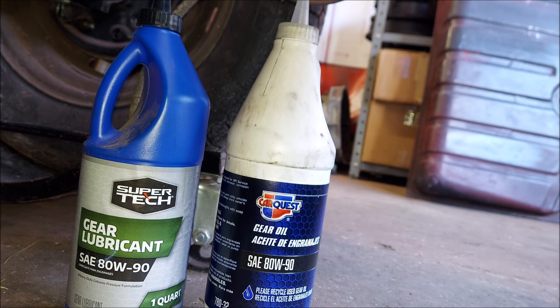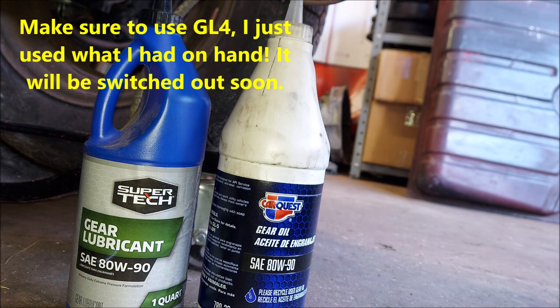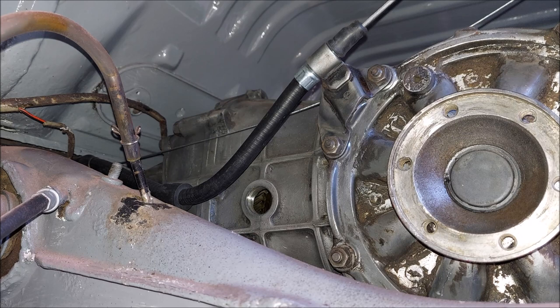Now you can use what you want to use. I have a bunch of different bottles — same weight, same GL number, everything. I use the old-fashioned 80-90 weight. Some people want to put synthetics in, like AMSOIL or whatever. I stay with what they used back in the day and I have never had an issue. Some people run straight 90 weight, but we can get into oil debates all day. This is what I've run forever and I've never had a problem. So let's put it in.